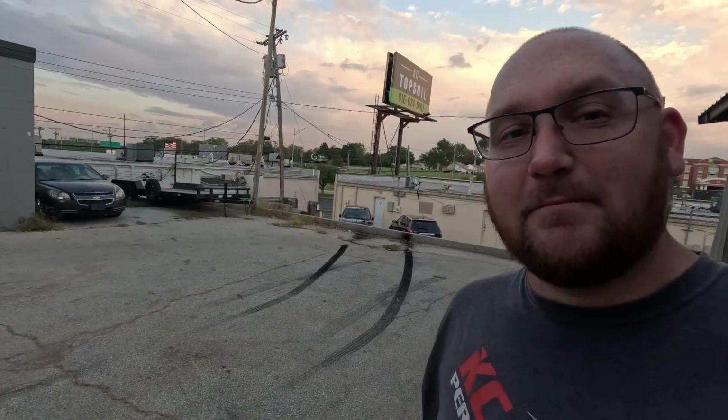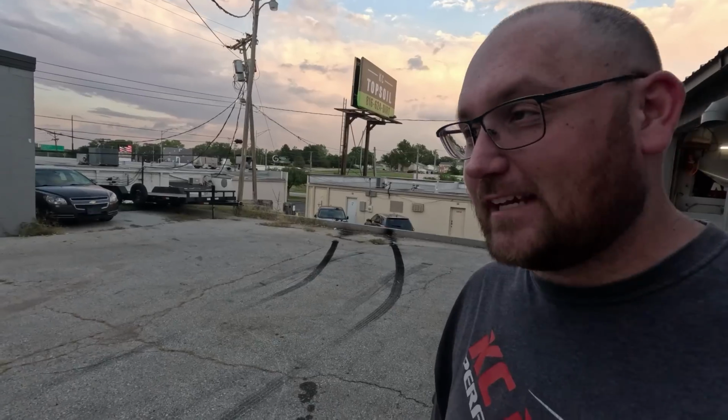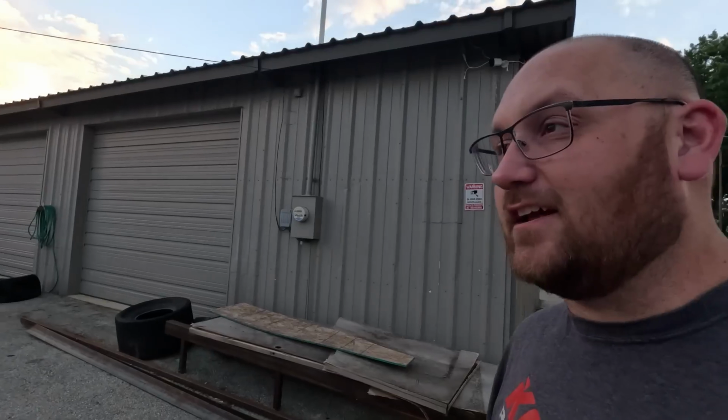And I was like, man, Brad, if you're gonna twist my arm, I guess I'll have to go out here and floor it for a second. So, pretty neat. I believe it's an 871 on top of a 540 big block Chevy, twin Holley 4500 throttle body units with injectors in them. It's like Sniper, but run by a Terminator X, injecting all the fuel through the blower. Pretty freaking neat. So enjoyed that.